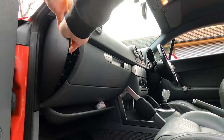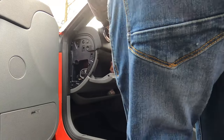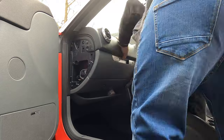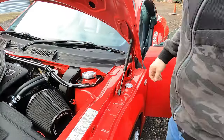So now it's time to remove the glove box. Remove the side panel and undo all of the little torx screws that are holding it all in. Then unplug any connectors that are connected to the glove box. Now just lift up the strip.